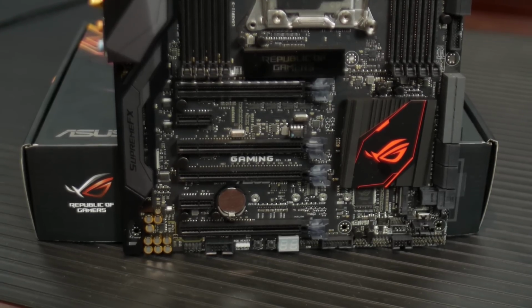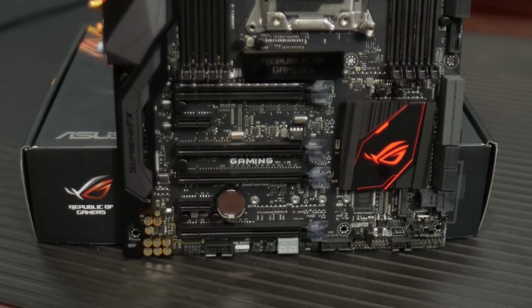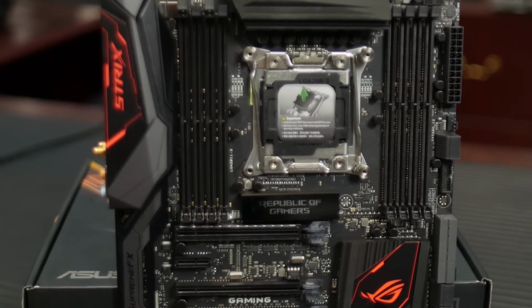Now, if you're running a 40-lane CPU, that opens up the other slots, but the by 4 slot is still that situation, owing to the fact that they didn't really want to deal with juggling that many PCI Express lanes. It's also true that the PCIe 1x1 slot, the by 1 slot immediately below the graphics card, shares bandwidth with the onboard Bluetooth Wi-Fi solution. Now, the onboard Wi-Fi Bluetooth solution is a 2x2 antenna, multi-in, multi-out. It also supports Bluetooth 4.1, Bluetooth Low Energy, and all of those standards.